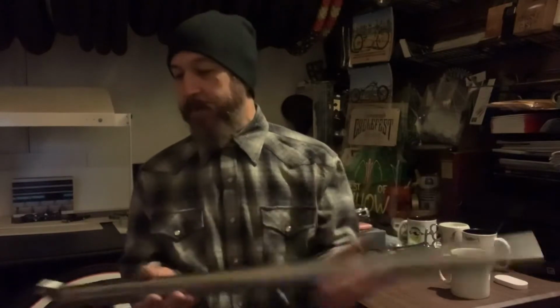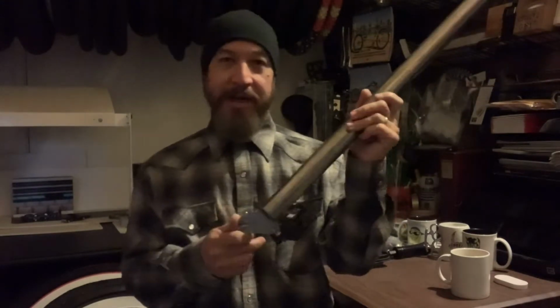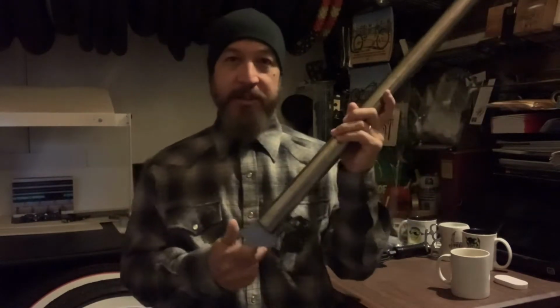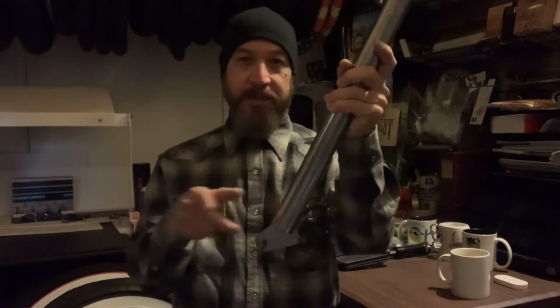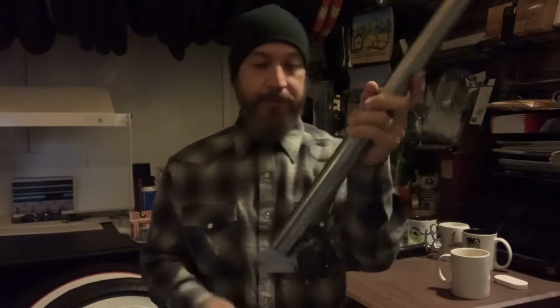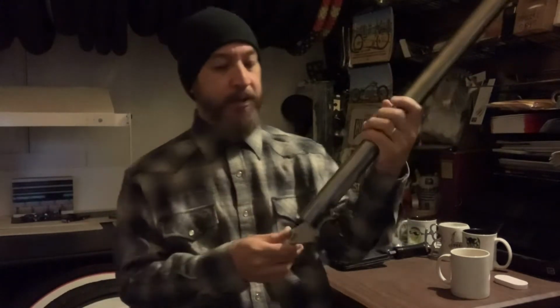Before we do, a few episodes ago I came up with a dropout design for non-extended forks for people who want the classic just tucked short fork tubes. And with that design, that had its limitations because all of the Peak Cycle forks run the axle in front of the fork tube, this direction. So in order to run a short version, we had to run a larger rotor in order for everything to meet and get enough bite on the brake pad, the rotor, etc.